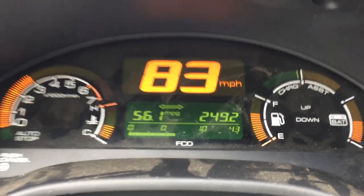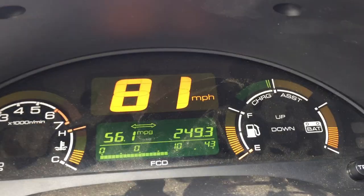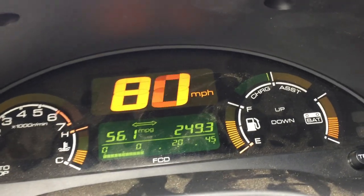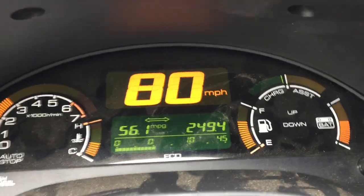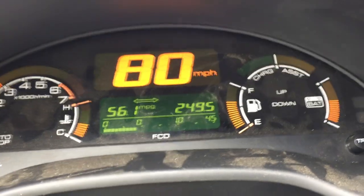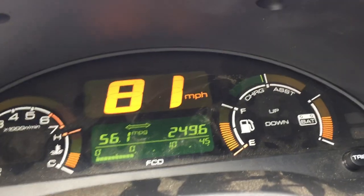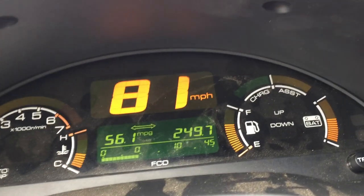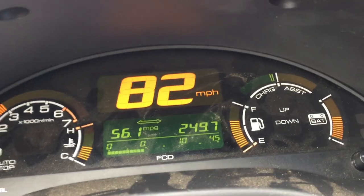So the first thing I've done is basically remap the bars to where each bar is 500 watts. Actually, that's incorrect. Each bar is 5 amps delivered to or from the motor. There's a bug right now where the kilowatts is not working correctly. But when that gets fixed, I'll map it to where it's 500 watts per bar. That way you know a true power, not just the current, which is a function of the battery voltage as far as the output power.